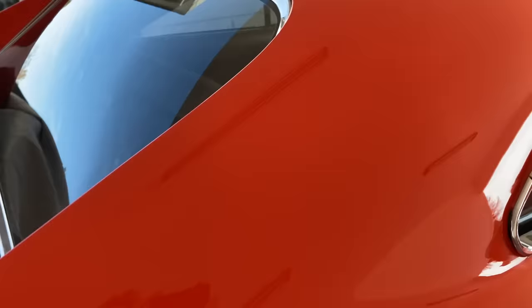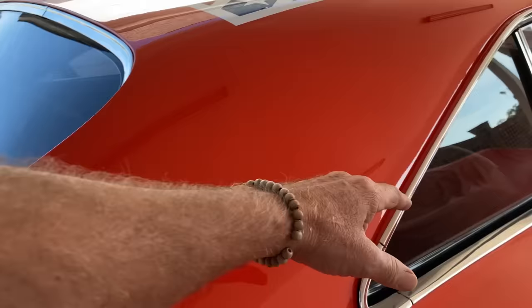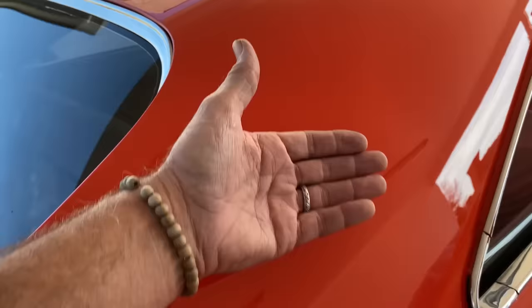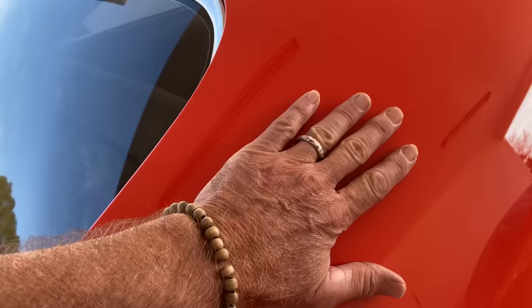Personally, I like it without the stainless because I like this line to be uninterrupted. Many times in the older cars — especially ours, because we didn't do much body work; we just wanted to make sure they would run and be able to jump another day — there's a seam right here that Chrysler never bothered to cover up, because every single one of these cars had a vinyl top. They were two-toned — usually black on top and then green, white, or yellow below. They didn't bother with body work here because it was covered up. That's why water gets caught there and it rusts out eventually.